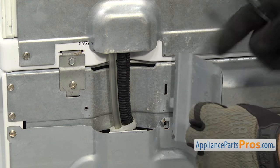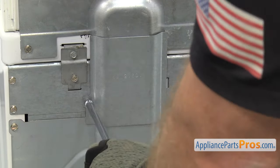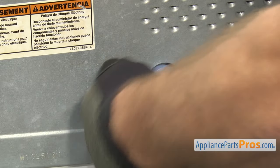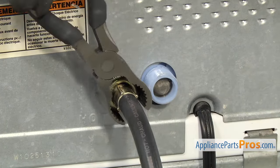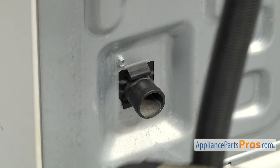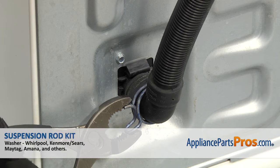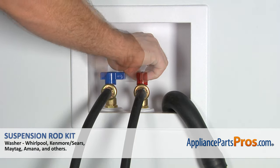Now we're going to use a quarter inch nut driver to put in the screws that hold the hinges to the top. Then we can put the cover on — all you have to do is line up the two tabs and swing it over, then use the quarter inch nut driver to put in the screw that holds it on. Then we can put the fill hoses on. You want to make sure you get the hot on the hot and the cold on the cold. We're going to start them by hand so we don't strip the threads and damage the valve. Once you have it snug, grab the pliers and tighten it down so you don't have any leaks. Now we can put the drain hose on — all you have to do is line it up on the fitting and push it on. Once you have it on, grab the pliers and compress the clamp and move it up on the drain hose so we get a good seal. Now put the washer back together, plug it back in, turn the water back on and take it for a spin.